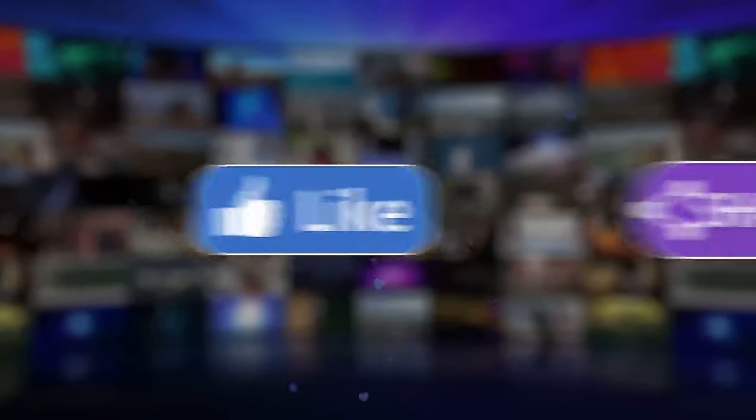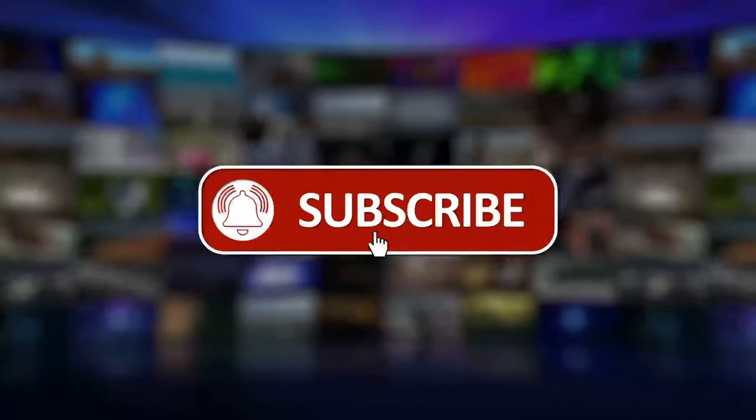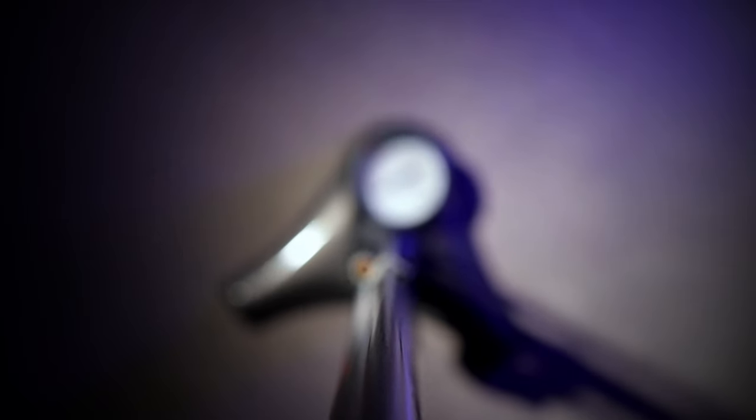So how do you fix this? How is there a way at home without any special tools to work out what is the right pressure to set that tyre at? You start at quite a high pressure, say 100 to 120 PSI for your normal older style rims, but you may need to check your rim and your tyre for maximum PSI because you don't want to go above the manufacturer's specifications.